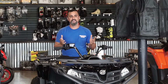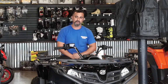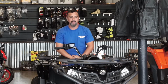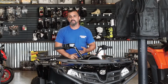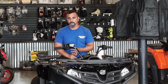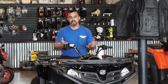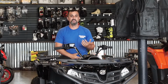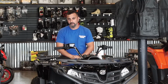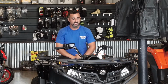Between 200 to 250 miles or 20 hours on your unit, you need to bring it in for your first service. The first service is going to be your oil changes and any grease fittings. We'll also check your transmission fluid, and if it does need to be replaced, we replace it at that time. Same thing with differential fluid, checking your brake pads, and making sure there aren't any mystery leaks or faulty calipers. We also check your air filter and your battery terminals to make sure they were adjusted properly and that all the screws are tight, and we give it a general look over as well.